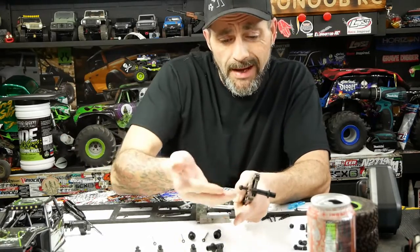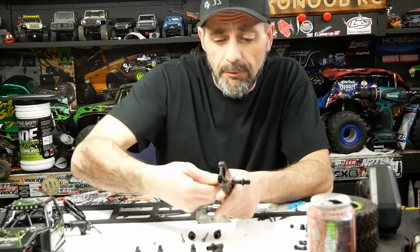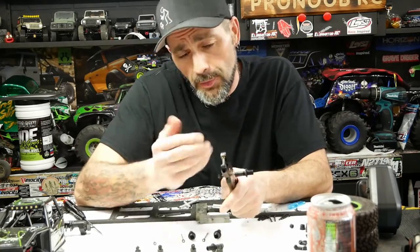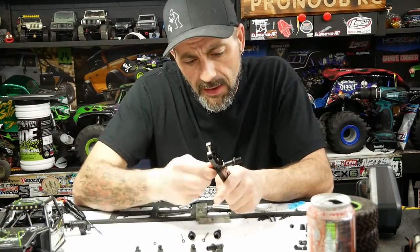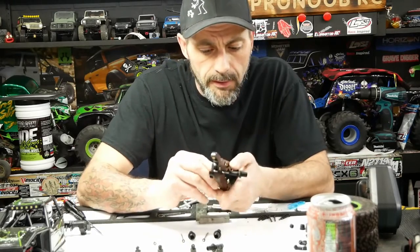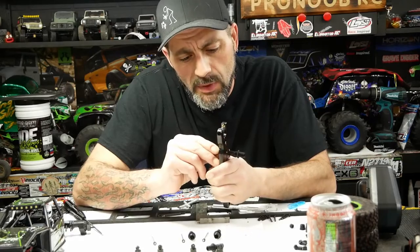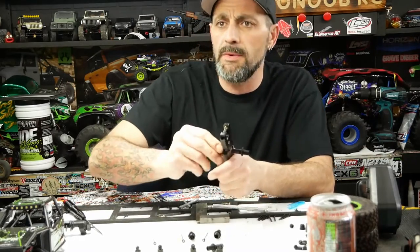After we put the cap on, I like to put the rod end on the bottom to get those threads covered up, so when we get to bleeding it, we don't run those threads through that bottom O-ring now that it's tight, and rip it out. You cause a leak, right? You have leaky, weepy shocks.